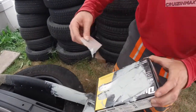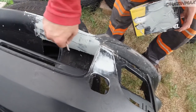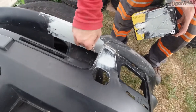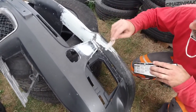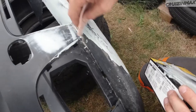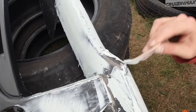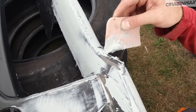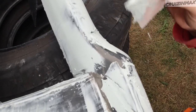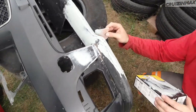That's it. We can always wait for it to dry, sand down the high spots, and redo the bondo again. You got a pinhole here - fill it in, man. Oh, there's air trapped into it. If there's a professional body man out there watching this, he's scratching his head. Sorry, man.